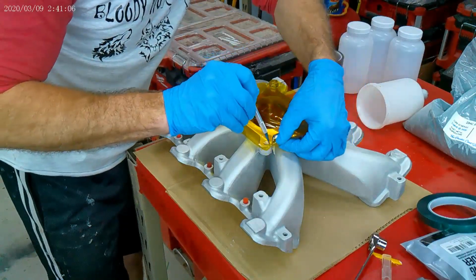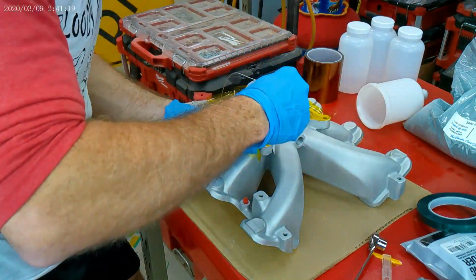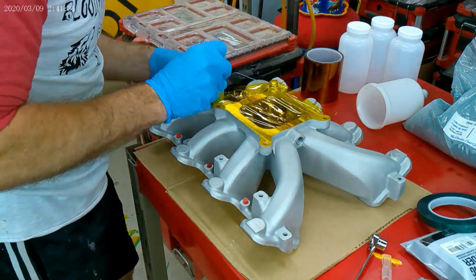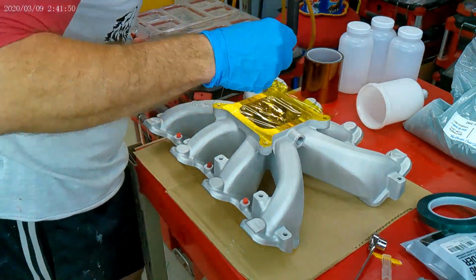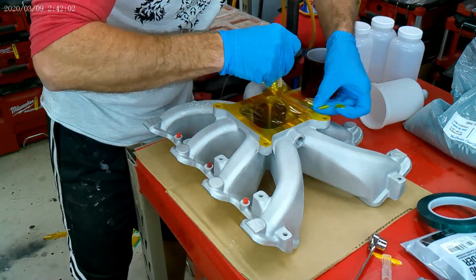So this whole time I've been preheating my oven. I got it working with 2 burners now, and it rolled right up to 450, where I set it. I just wanted to get the part thrown in there, get it warmed up and baked off for a few minutes. Then it should be good to go for first coat of the zinc rich primer.